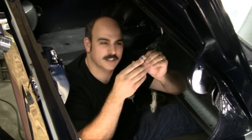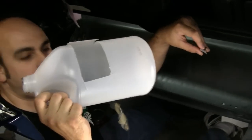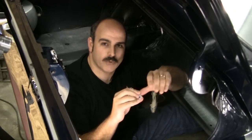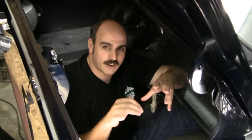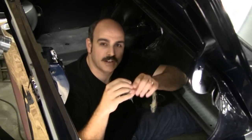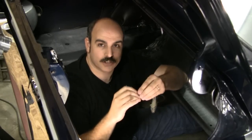Now we're ready to install the door handle. You may have noticed the bolts we're using — we've got little plastic washers on those, cut out of an old vinegar bottle. We're using those just to protect the paint because as you're sliding things around making things fit, you don't want to scratch your painted surfaces. Once you have a final fit and you're happy with everything, one at a time you can remove the bolts, pull the washers out, put the bolt back in, and that will protect all your visible painted surfaces.